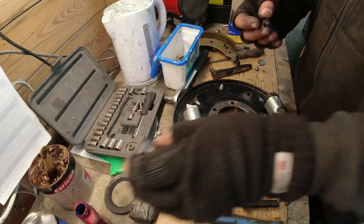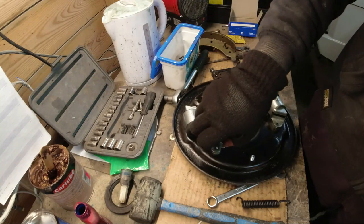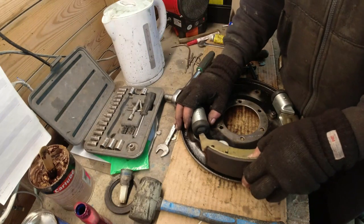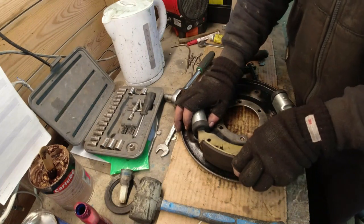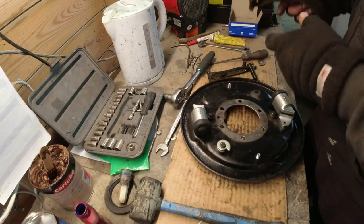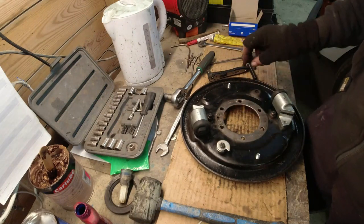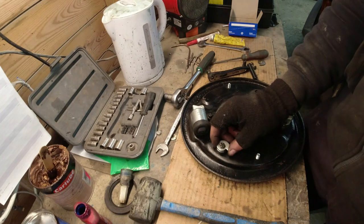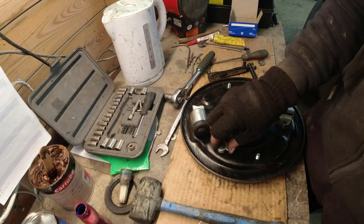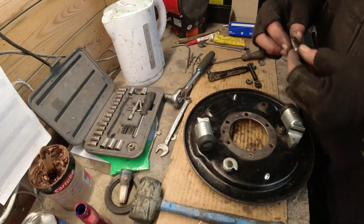If it does come apart again, it's going to be with an angle grinder. So I don't mind about thread locking this in, because it's going to stay in there. This shoe actually fits in it now. And of course it does. It sits down beautifully now, and it's miles away from the head of the bolt. So that's all it needed, was these doing up properly. Two issues. First of all, I think that the washer was the wrong side. And the other issue was that the bolt hadn't pulled the cam down tight enough. It's not difficult, folks. It really isn't.